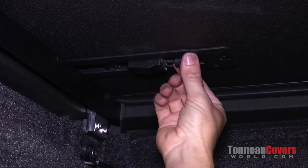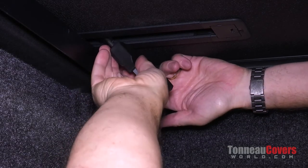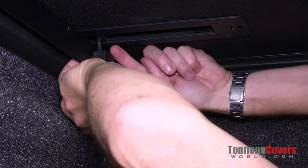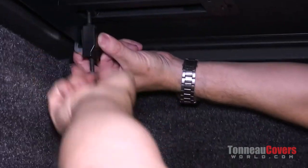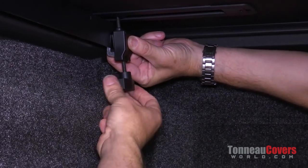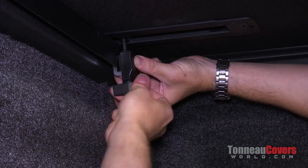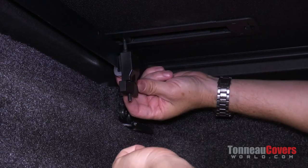Now that we have it centered in position, we're going to very gently fold it up towards the cab and set the clamps at the front. For the front clamps, turn the clamps just a little bit — the secret is knowing how the clamp works. It has to be at about a 45-degree angle before it can slide. Once it gets over to the bed cap and you rotate it in place, it will no longer slide — it's impinged in place. Slide the clamp up, then turn the star knob until it gets all the way up to the clamp, which locks it in place. Get it nice and snug and do the exact same process on the opposite side.